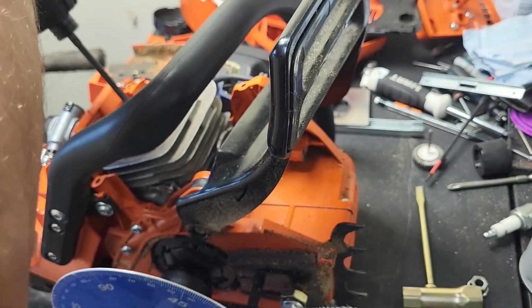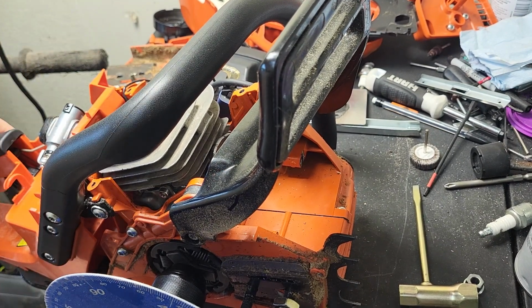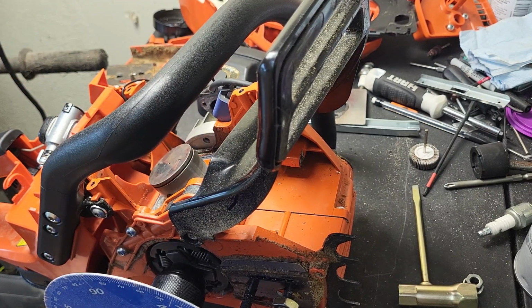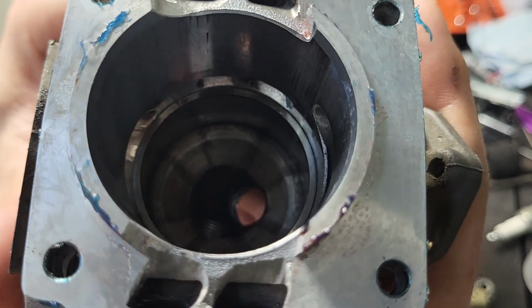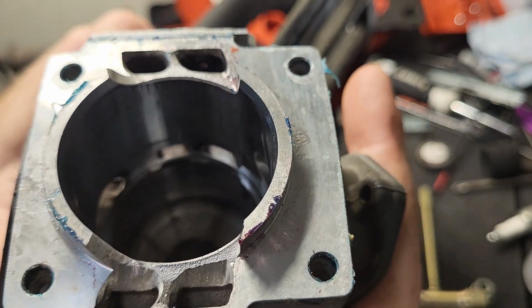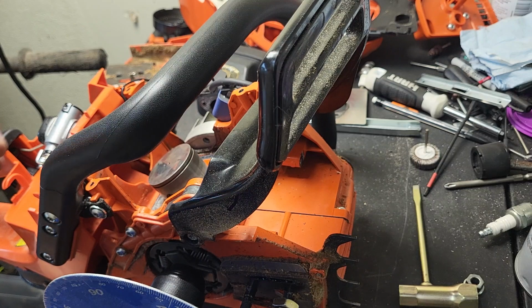We pull the cylinder off. And the ring is going to be sitting there right above where the transfer is currently located. And looks like we got a winner. If it'll focus down in there. It ain't gonna cooperate today. But ring sitting there right past transfers. So get them marked out. Set the saw to the side and then I'll start grinding.